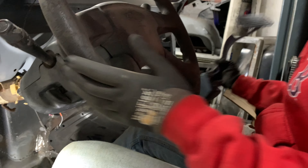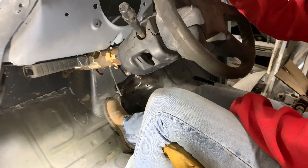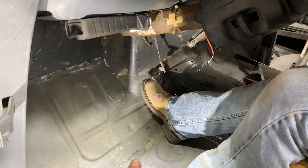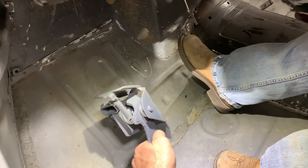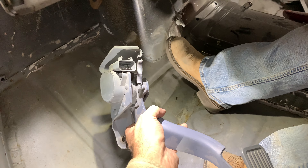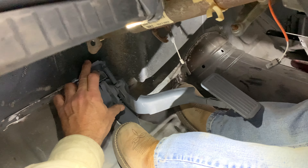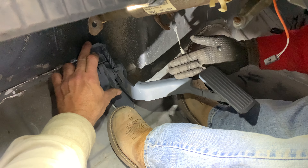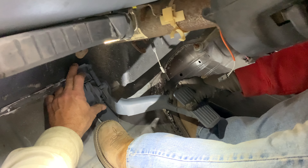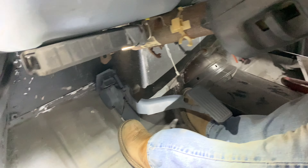Let's talk about the gas pedal. Bridget, go ahead and put your foot where you think the gas pedal needs to go. We measured this and did a 'feel test' — Bridget's sitting in here driving and moving her foot as if using the gas. This is the gas pedal assembly that came out of the '03 truck; it has a sensor in it and this is what will run your vehicle. We found a place where it's going to bolt in. We're going to take the metal here and bend it so it fits exactly where it should go underneath your foot — right now the gas pedal is too long, sticking up too far from the floor.